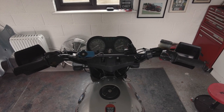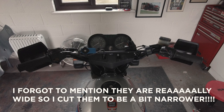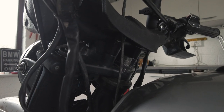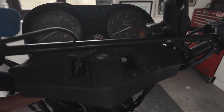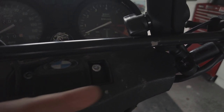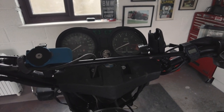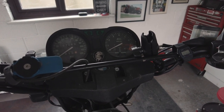The handlebars on the bike are the Tomaselli off-road high bars, which you can find on the Motorworks website. To get a little bit of extra raise I've got the 25mm risers from Motorworks. It could have gone a little bit bigger, but the problem with the ST clocks is that going higher starts pushing and fouling things up. I've actually removed those little switch holes so it wouldn't push things up too high and look really ridiculous.